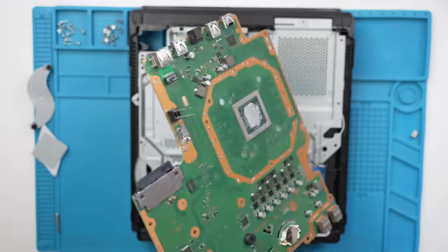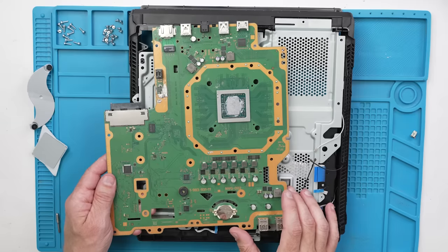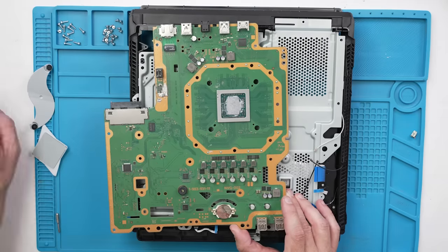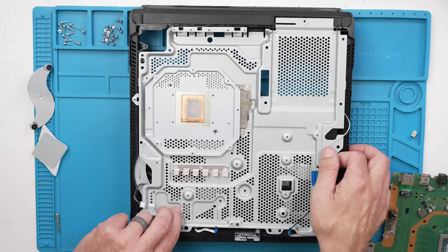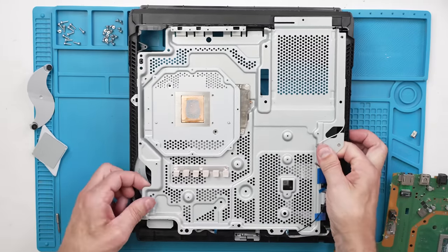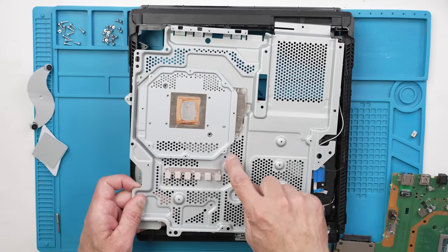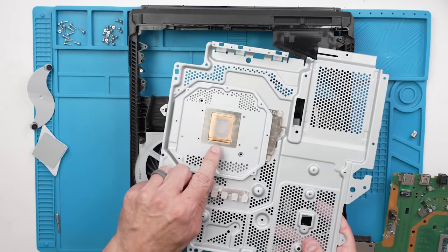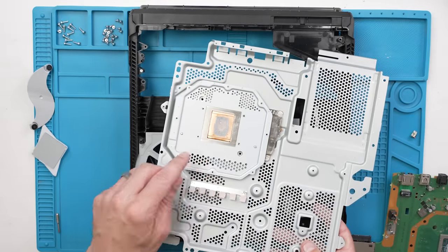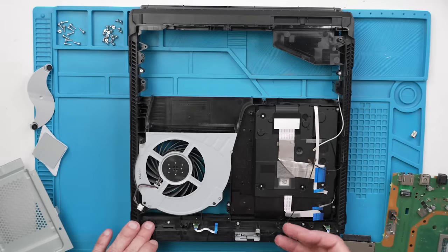Let's see what's under the motherboard. We've got a ton of solder over here, but I don't really see anything that should be causing it to pop up like that. Somebody removed this metal plate and didn't put it back together correctly — these screws right here need to go through this metal plate. And obviously there's not the perfect amount of thermal paste. The sort of good news is I don't think they messed up the disc drive, but it looks like a lot of other pieces of this PS4 they did mess up.